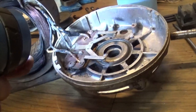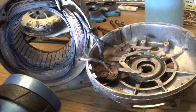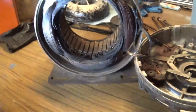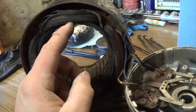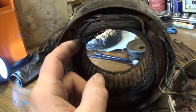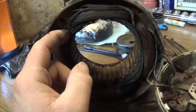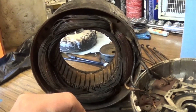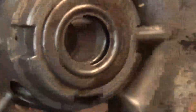It kind of makes me wonder - what if I just chop the wire that feeds power to the start winding? I wonder if the primary winding is actually messed up, or if I just give it a spin, would it take off and work? I don't really want to mess around with the wires too much. But if that overheated start winding ended up burning through somewhere and shorting, then it's still going to be over-amping. If that's the case I'll just move all the start windings away from the run windings and see if that makes a difference. It would be super cool to see this thing actually work.